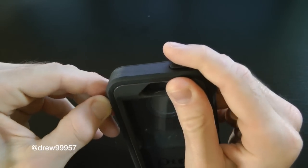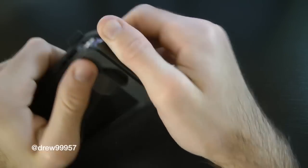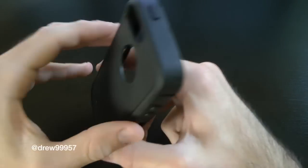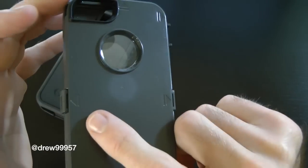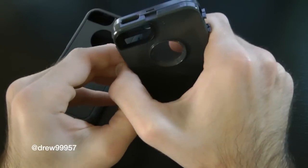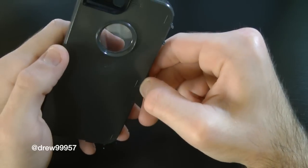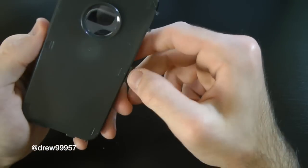Let's go ahead and take this apart. Start by removing the top icon, open up the vibrate switch button, then work your way from the bottom to the top and massage it off just like so. There's the rubber piece — it's now off the casing. Here's the actual hard shell itself. Remove the two arrow clips here and up top: take your thumbnail and peel it apart until you hear it click. Do the other side — sometimes you might have some difficulties, but it should come off just like so.